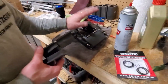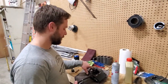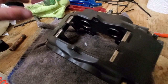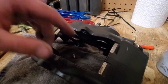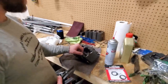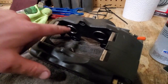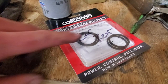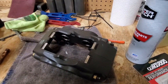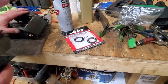We just got done rebuilding the third caliper of four. These are four-piston calipers off of the Superlight model — aluminum Wilwoods. To service these calipers, there are little pistons in here. You basically put a little air nozzle on here and push the pistons out. Inside the bore of that little cylinder there's a little seal, and you replace them because they're rubber — they go bad, dry out, lots of heat and all that stuff.